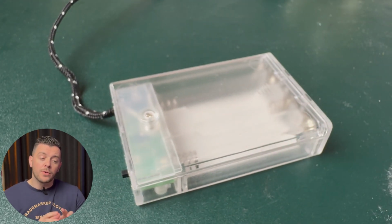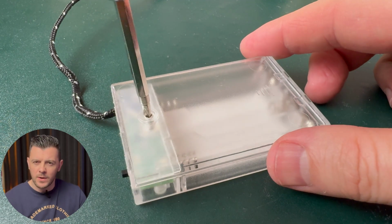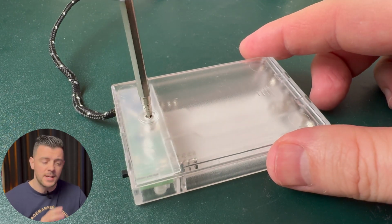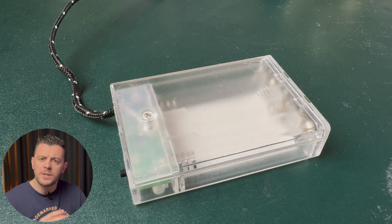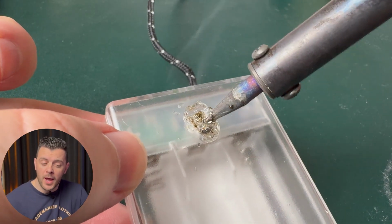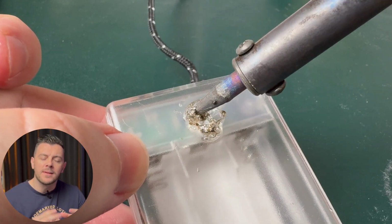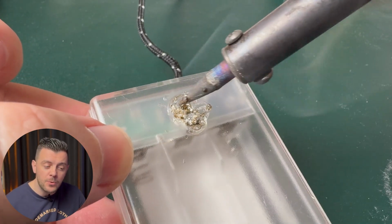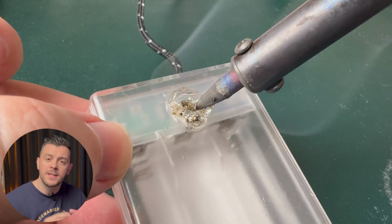So in order to not throw everything away, because I paid like $15 for this LED housing and LED light, I'm gonna use one simple method to remove this screw completely. I'm gonna use my old soldering iron. I'm gonna heat it up just a little bit and melt the plastic around this screw, and eventually I'm gonna pull this screw out from this plastic case.